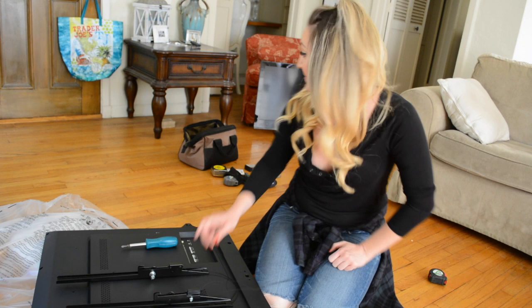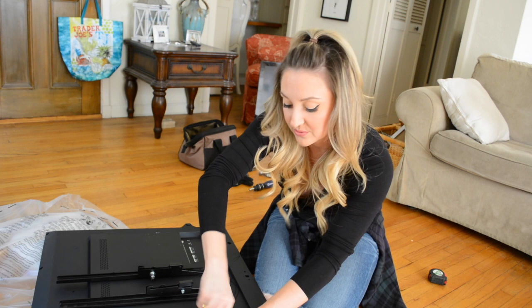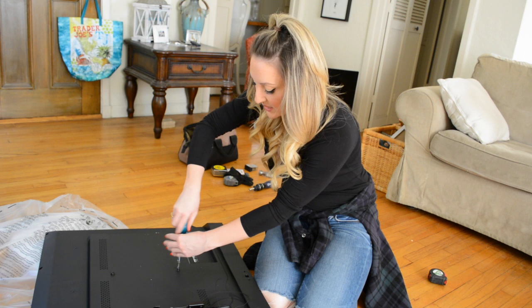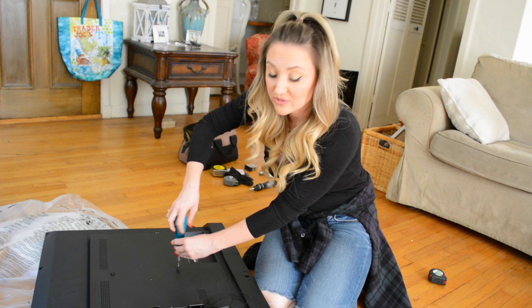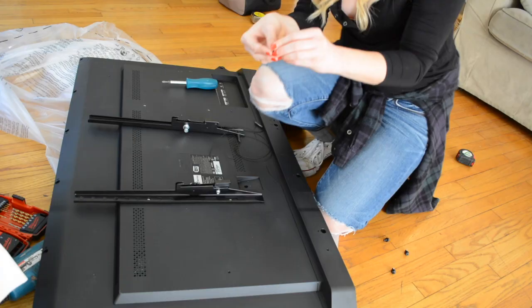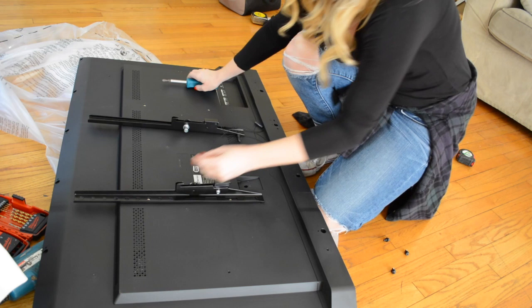You can see I had a very tiny TV being replaced. Take a regular screwdriver and undo your screws on the back of your TV — these access the holes for your wall mount brackets. The reason I'm using a hand tool instead of a power one is that when you drill these back in, you could possibly damage your TV with a power drill. You really don't need more power than your own hands. You have your bolts and two washers, and you just screw those right back into the holes they came out of.